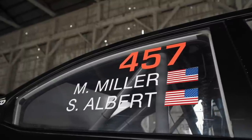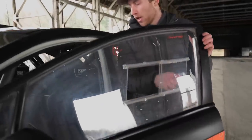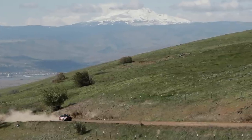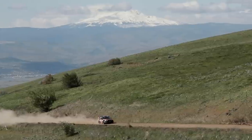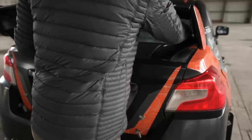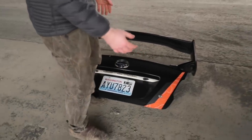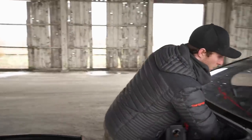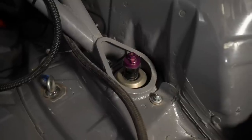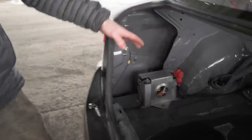We have Lexan windows all the way around the car to keep weight down, and they're super functional — this one has a little slider so the driver can get some air or hand their time card out of the window. Another feature is we cut a lot of sheet metal and weight out of the car to be competitive — it's right on the cusp of the weight limit for the rule set. There's no rear speaker tray and no hinges for the trunk, so the trunk comes all the way off, making it super lightweight. That lets me get back here where there are suspension adjustments on top of the struts, the battery is relocated to the back, and there's room for tools as well.